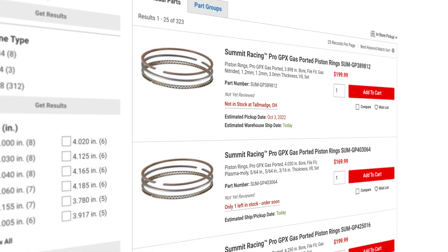We can gas-port it. We can make that piston ring behave much better, working when it has to. From there we go down into the 1/16, 1/16, 3/16 — sort of high performance but not really. Then you've got the 0.043, 0.043, 3mm, which has been used basically since the 70s, racier even yet. Then we get into the metric sizes — the 1.5/1.5/3, the 1.2/1.2/3, and now the 1/1/2mm ring sets commonly used on the LS. Basically any piston we carry in any bore size, you're going to find a GPX ring set for it.